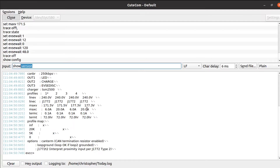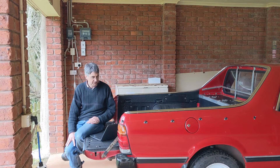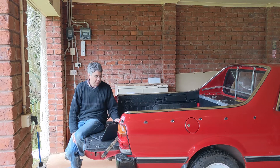Show history tells you how long the charge took, how many kilowatt hours there were, the maximum charging current, and the reason why it stopped. For this last one it says 'EVSE disconnect' — so I turned it off at the EVSE. This one shows about 2 kilowatt hours and got up to 168.3 volts. I haven't found the watt hours to be particularly useful — it doesn't seem to relate to reality in my particular setup. I'm not sure if that's because of the charger, which may be reporting back a different current than what the EVCC is expecting. But you can still get some useful information from it.